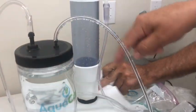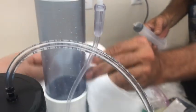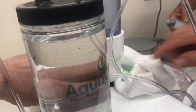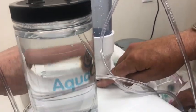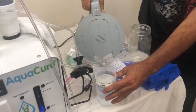So that's right. You don't even have to hold the cloth up there. If you just put the cloth down here, any drips would just drip onto it and keep it from going further, because down here this black ring underneath actually isn't sealed, so any water there could drip into the machine. And then when you take it out of here, you just use distilled water to bring it back up to the line. So you refill the humidifier.